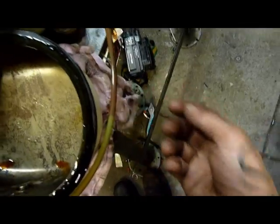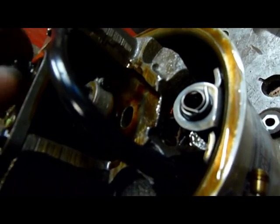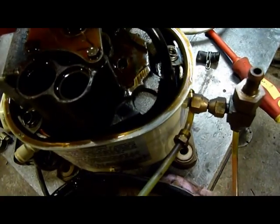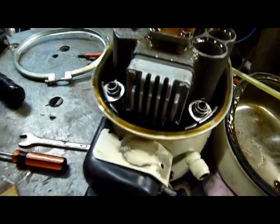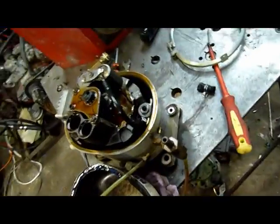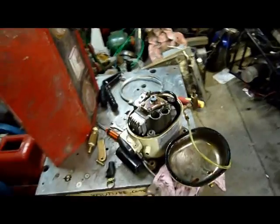I think the reason there's oil in there is because this unit's been upside down and pretty much every way it shouldn't be, but it's all there. The connecting rod looks alright. I think the main reason I wasn't getting vacuum was because it wasn't connected, or at least not properly. This thing smells bad — it's done a lot of hours of work. The head's cast alloy instead of iron and finned for cooling. It'll work, but it'll be nasty. Motor windings still look fresh — they're not burnt or brown. Well, that's the end of that one for now. I should run the compressor but I can't be bothered tonight. Thanks for watching.